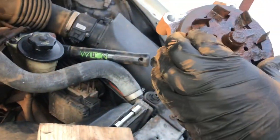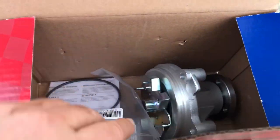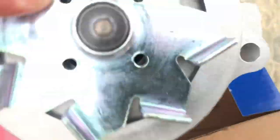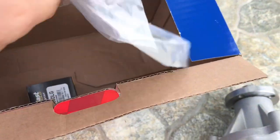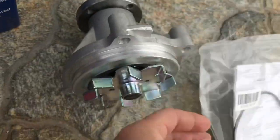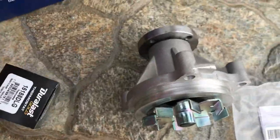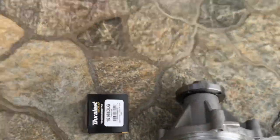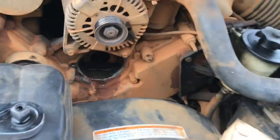This is it — this is the water pump. Let's go get another one. Okay guys, we got the new water pump, nice and clean. It comes with an O-ring. I'm gonna put the O-ring around here. We also got a thermostat — we just gotta clean this out a little bit before we put it in.